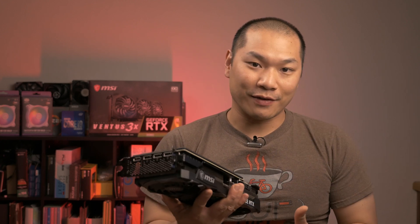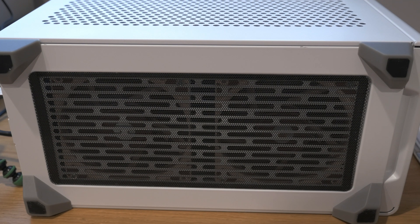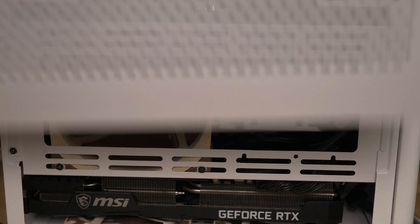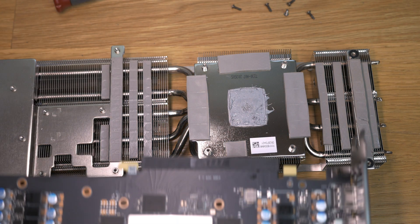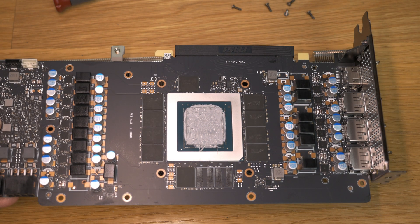What I did in these scenarios was check the card for anything pushing down on it or for the power supply cables tugging on the card in an unbalanced fashion. I checked all the screws on the back to see if they were tight, which they were. When all these initial checks passed and the temperature was still running high, I turned the case on its side, relieved the weight on the PCB, and allowed it to rest for about 10 minutes. When the case was turned back upright, the problem went away. This didn't really happen repeatedly, but I did want to note it because I don't think this is a thermal paste issue. When I tore down the card I noted ample thermal paste present, and after that for the remainder of card testing I didn't observe this happening again.